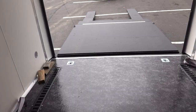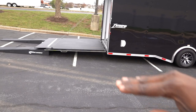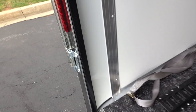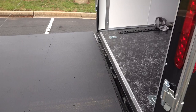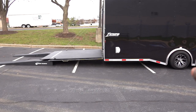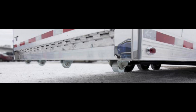The last two things are the most important. I went with a spread axle and also a beaver tail. A beaver tail basically allows the trailer to have somewhat of a slant in the rear — you can see on the inside how the floor kind of goes down, which gives you more clearance. The only issue with a beaver tail is whenever you go up a steep driveway, the trailer is probably going to drag. What I should have done was added some rollers under the trailer so that if it bottoms out, I don't damage it. That is an option at the manufacturer, and I wish I would have added that.